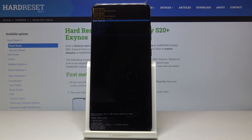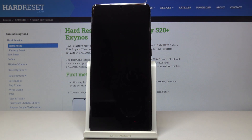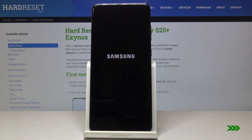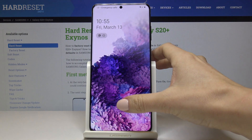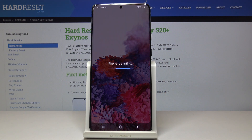So we've just done it. All you have to do now is pick reboot system now. Click on reboot system now. And that's it. As you can see, we are back in normal mode and you've just wiped the cache. Congrats.